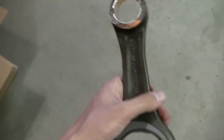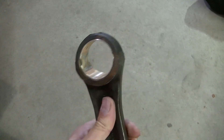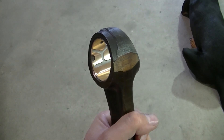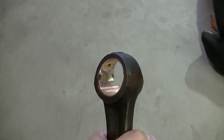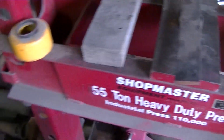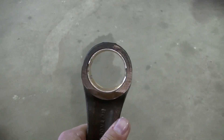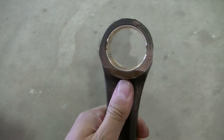So I've run into some issues here. I pressed the new piston wrist pin bushing in, and I kind of had to rig up the press because I don't have that tool. So I've been improvising. After I got it pressed in, I test-fitted the wrist pin and apparently I'm distorting the bushing as I'm pushing it into the rod.